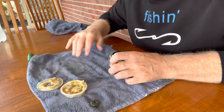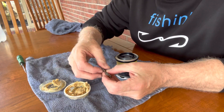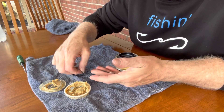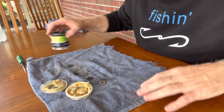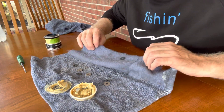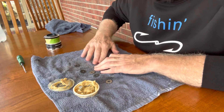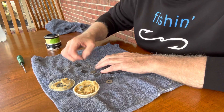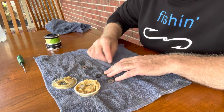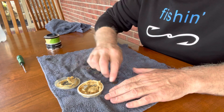Okay, it's nice and clean in there now. I just lay them all out separating them in order on my cloth, then use the cloth to pat them dry and give them a wipe off. Make sure there's no damage to those washers. If the metal washers have got any roughness on them, you can use a bit of light sandpaper — like 600 or 800 grit — and give them a clean up. These feel pretty good; I'm just cleaning up any old grease and any moisture on them.